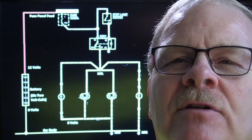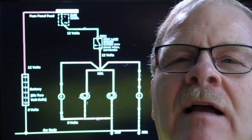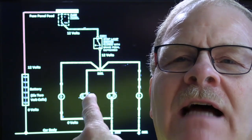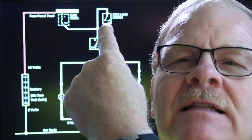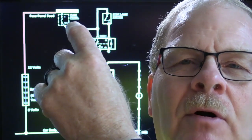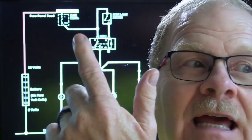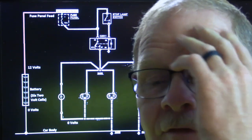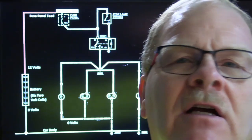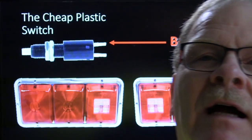That relay could handle just about anything. Let me back up and show you what it looked like before — that's where the stoplight switch was. You can see how the switch was carrying all the load of those lights. I'd replace the stoplight switch with a new one because it would be melted and burned on the inside and locked up. I put a new stoplight switch on it, and it actually had a Ford part number. I'm a little confused about why Ford was using a GM-style stoplight switch.